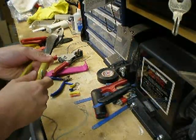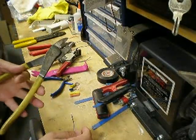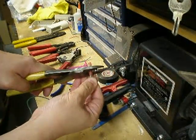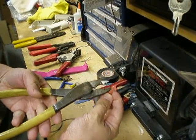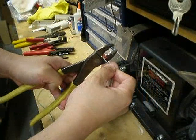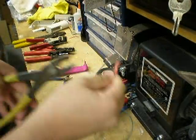Now, as far as crimping, instead of using this type of crimper, I actually prefer to use this one for automotive use at least. This is great for most of the common butt connectors. The way you use this one is: put the crimp on, feed the wire in, give it a squeeze. The reason I like this one is because this crimper actually has a lot of leverage, and it's very easy to make a really good crimp. I'm going to put the other piece of wire into the butt connector — let me just twist this up — put this in, give it a squeeze. And that's it.